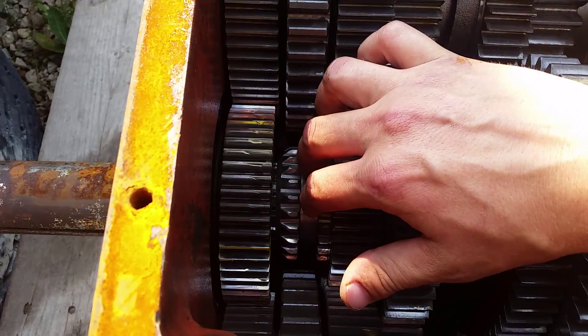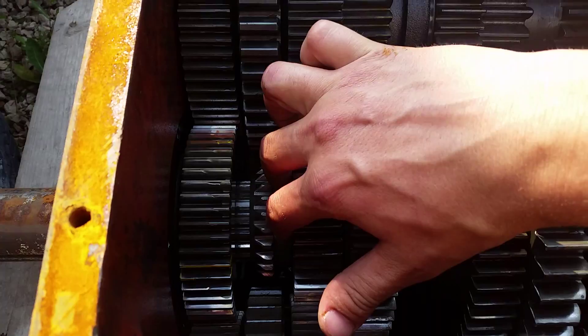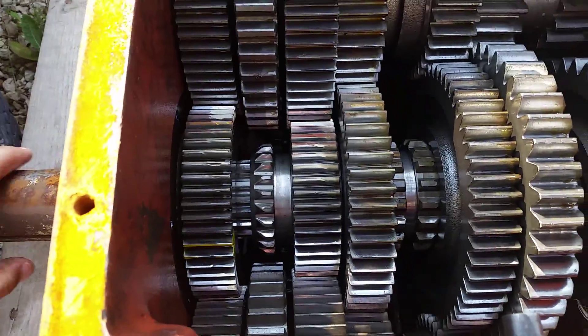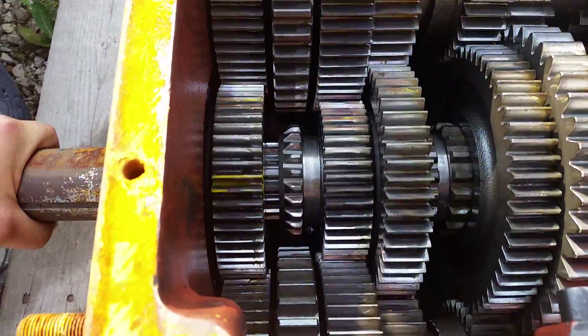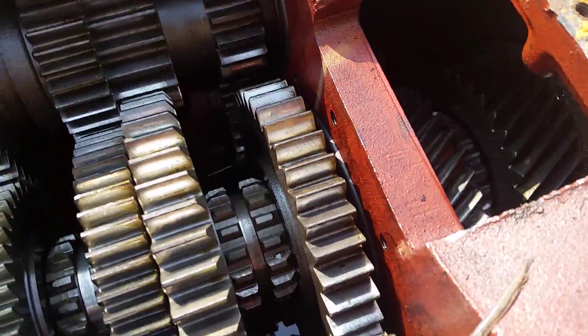So now what we must do is match the gear and the sliding clutch. And with the shift lever, the RPMs are then matched with the gear, and now that the sliding clutch is selected, we now have power flow out the back box of the transmission.